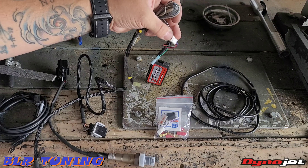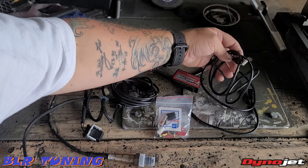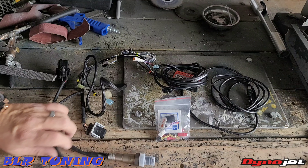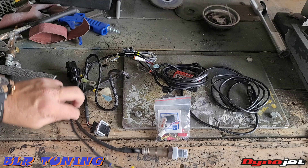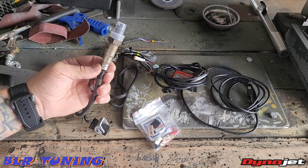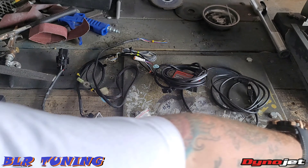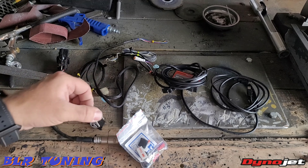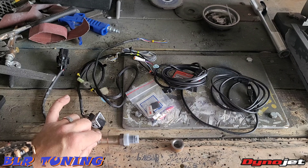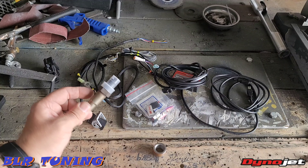We're not going to be installing an AFR gauge, but you can — DynoJet does offer one as well. I'll put a link in the description below. It does come with the USB cable to plug into the computer, it comes with the CAN bus cable, it comes with everything you need to do the install — you just need the tools to do it. We're going to be removing the seats and removing the right-hand side panel so we can get in there where our O2 sensor wire used to run, and we're just going to follow that same route for our new O2 sensor wire. You will need this bigger — I believe it's an 18-millimeter bung — and it does come with one. That bung will get welded into your exhaust pipe if you don't have one already there. Some aftermarket pipes have one. We're running a full Akrapovič setup that does have this size bung already in it, and we've already removed the factory plug so we can just utilize that hole and put this little plug right in there.